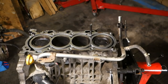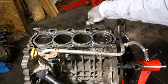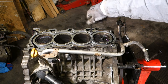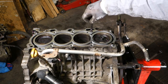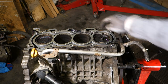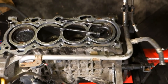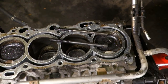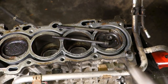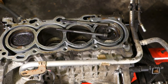It is so easy, it is loosened already, because there is no tension. And then I can only rotate that. Look, so easy. And I insert that part in here. It's so easy to take out. Okay. And there is this bad cylinder head bolt. And this is okay. And now I have finished showing how to remove this bad cylinder head bolt. Okay. And then we need to install new bolts. And then we can install the cylinder head and parts back.